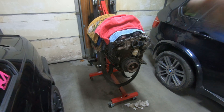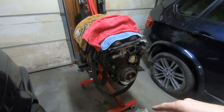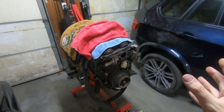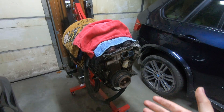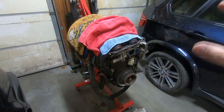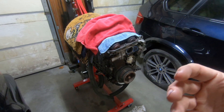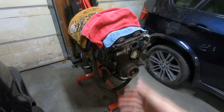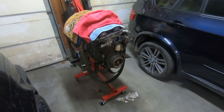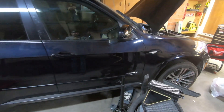I've got to get this engine torn apart so we can bring a new engine from the junkyard into the garage and get it to the machine shop. We're getting this down to the block — I have a 330 crank for this and we'll get that polished and cleaned up, re-hone the cylinders. I looked into port and polishing the head; we're still debating it. With forced induction cars it doesn't matter as much, but even smoother power delivery might make it worth it.